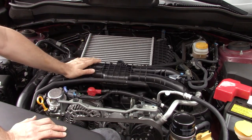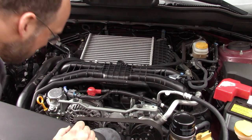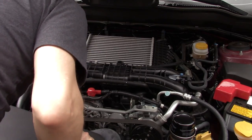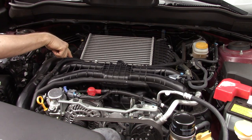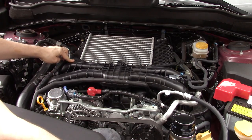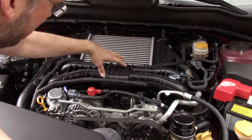But many cars come with direct injection now. You have BMWs and Hondas and whatnot. So I'm trying to figure out the best possible place to inject the carbon cleaner into the engine. It says a central vacuum point. And I see there's one here. It goes to something, but that's on this particular intake runner here. So that's not very central. I'd really like something kind of over here in the middle.